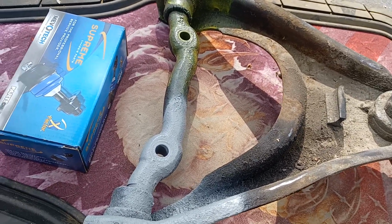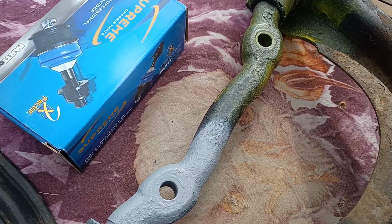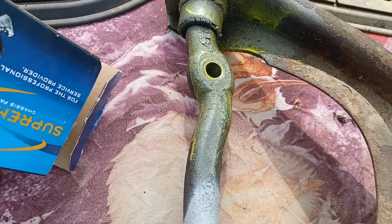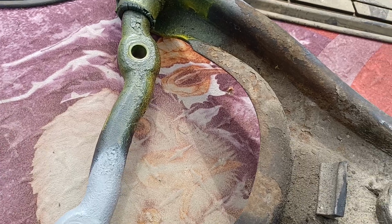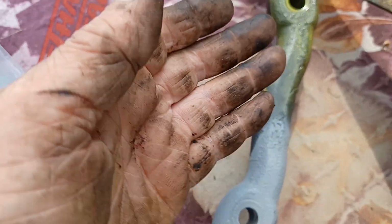Now, this is the control arm out of this 69 Cadillac. What I've done is I placed it in the position that it's bolted onto, and I put a little gray primer over here and a little yellow paint over there, and that's going to mark how the shaft goes back in to here. Once they drive these bushings out and put the new bushings in, a guy could get this thing out of kilter. When he pushes these new bushings in, up there and down there, they could have this turned around or maybe flipped around, so it could be all out of whack.